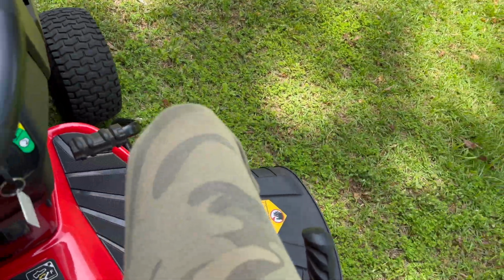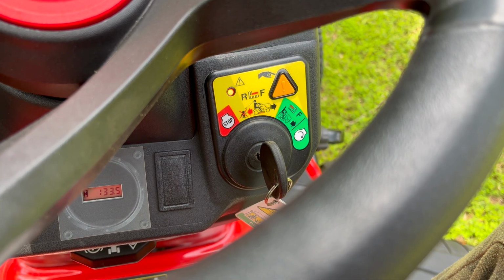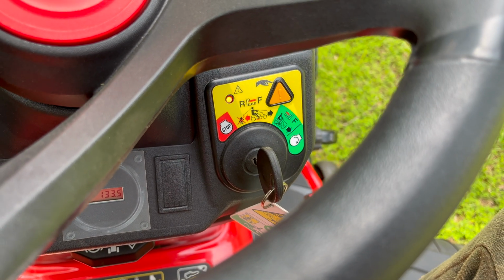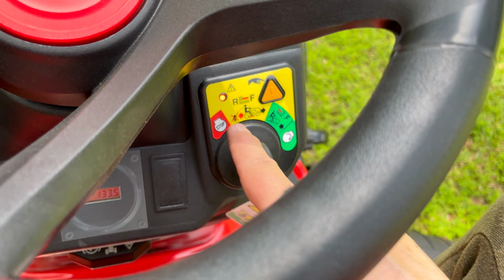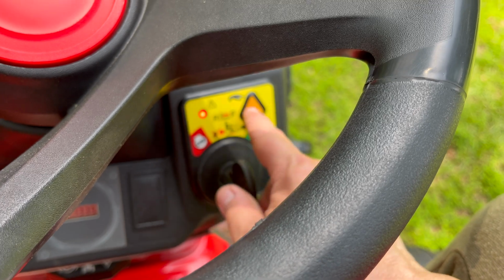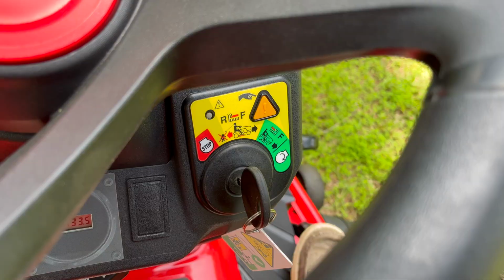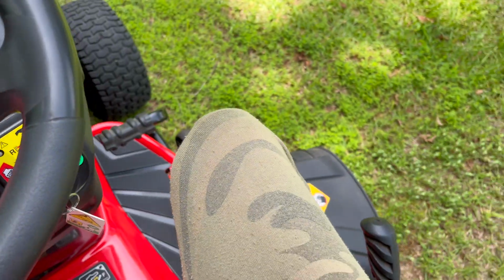It's in the instructions. I'm really shocked that this many people haven't picked up on that, but I guess if you've never seen it before, I just know from many mowers that I've seen over the years how this works. That red light has to be on. Now if the red light goes off, it will quit mowing in reverse. And I've noticed I can bump it accidentally with my knee. You see there I've mimicked it and the light goes off.